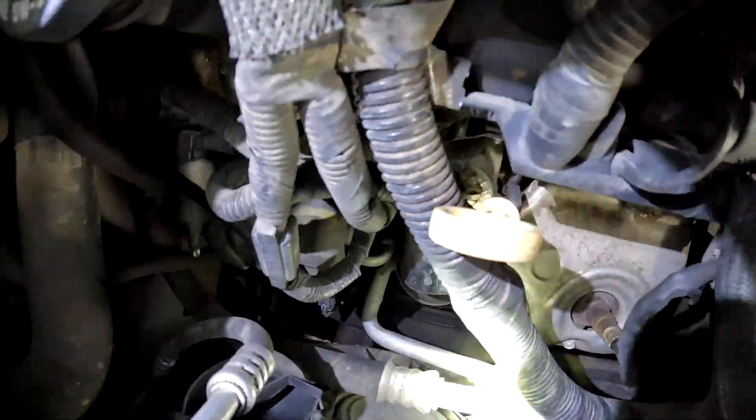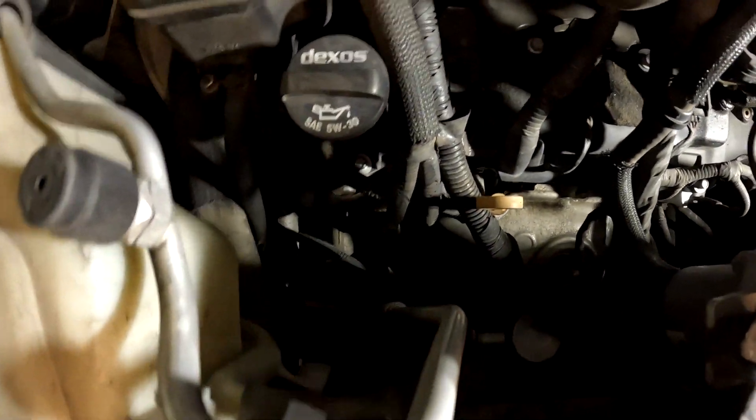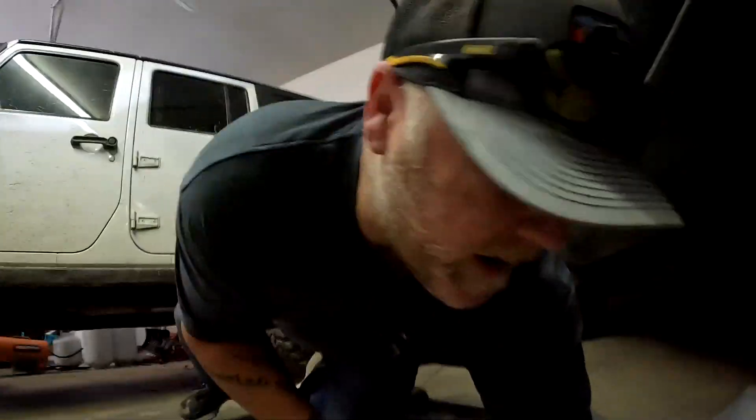The thing I've found is I actually access the oil filter through the top. You're supposed to only hand-tighten these things, and a lot of people — if you're like me with a strong grip — sometimes over-tighten them because you're always afraid they're gonna come loose and pop off.